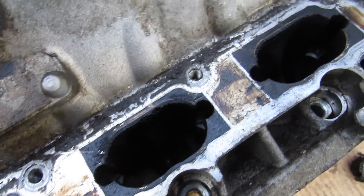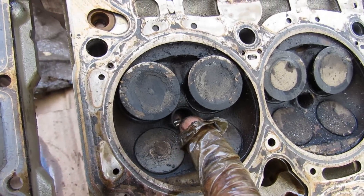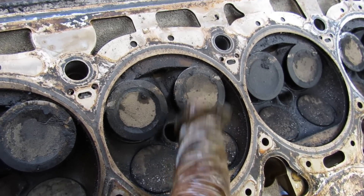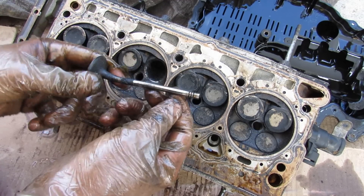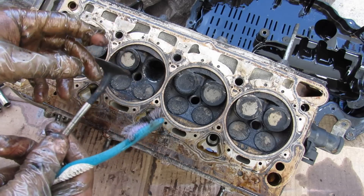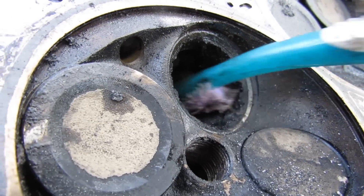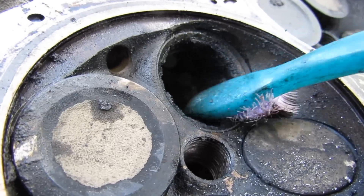These injectors spray fuel directly into the combustion chamber, which gives more power and better fuel economy. However the big disadvantage is that there's no gasoline to wash off the back side of the intake valves, resulting in heavy carbon deposits that can cause idling issues or affect overall function. Now for the catastrophic damage — the bent valves. They're not seated in their home position, and with no camshaft installed they should be closed like the exhaust valves. But they're all bent, pressing against the head face instead of seating, because the pistons collided with them when timing was off. To clean the intake ports you'd need to remove the intake manifold and walnut-blast or abrade the ports and valves, as the carbon is very stubborn.